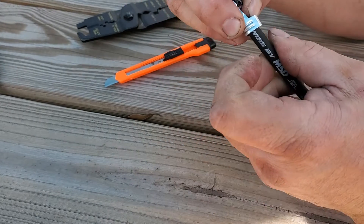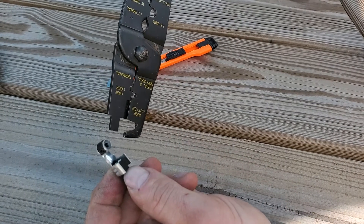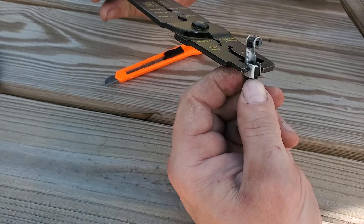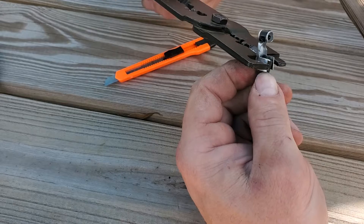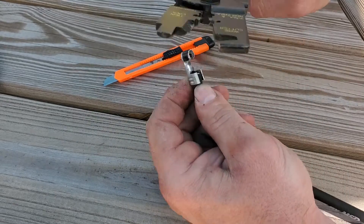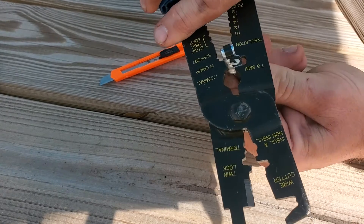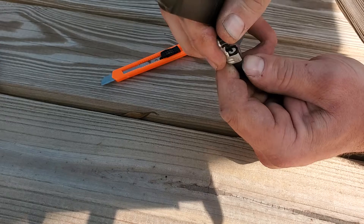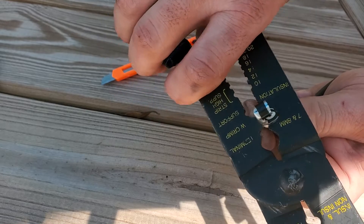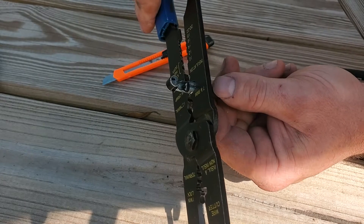The end here doesn't want to stick right down the edge. You'll have these pliers you can pick up at the auto parts store when you grab your wires. Just bend over these tabs here to help get it started, then use that crimp tool — place it in like this, get it right up there on the edge, and give it a crimp. Then get another crimp right there on the backside of it.